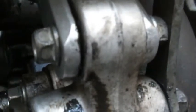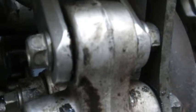Nope, I was incorrect. Everything down here fits perfectly. The rear shock linkage and the shock itself all clear the dog bones on both sides. This one actually has like a millimeter and a half. I can slip a couple business cards in between there. I've just enough clearance to make this all work out.